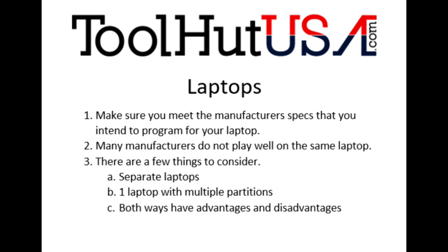The next thing to consider is a laptop. Do not try to use the same laptop that you use for service information or writing work orders — don't do it. It's a tool. Buy a laptop for programming. Make sure it meets the manufacturer's specifications for the brand you intend to program, so when you call their tech support they can't say it's because of your laptop. Make sure the required software is properly loaded — that's the Java, the Air, all the little things they need. Make sure you have the right browser, right operating system, right hard drive, right processor — all of it.